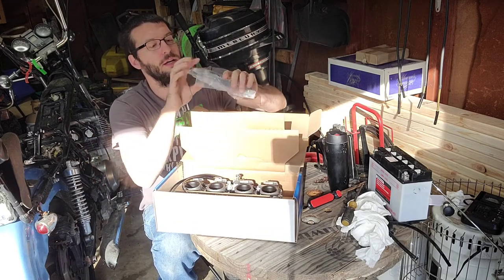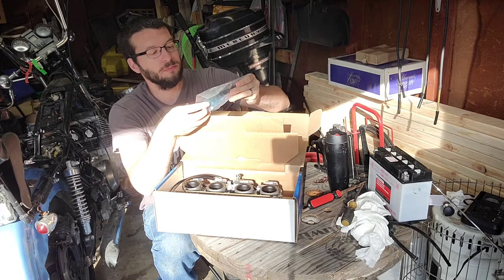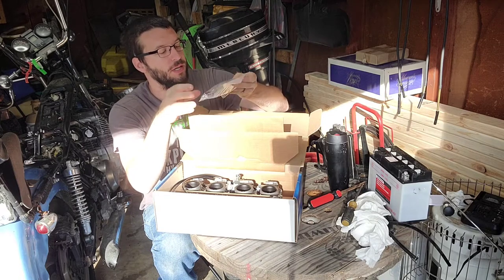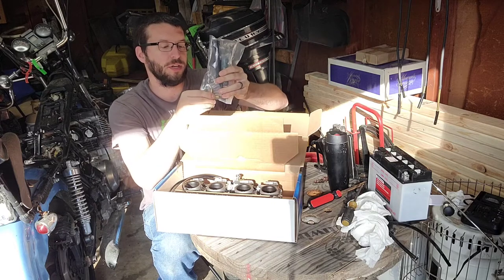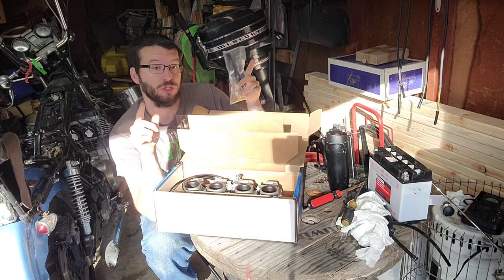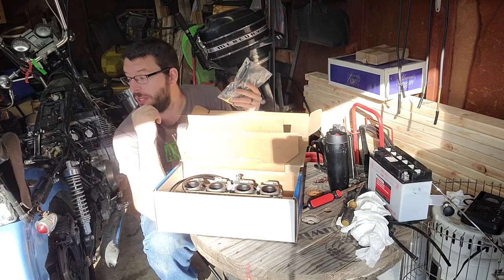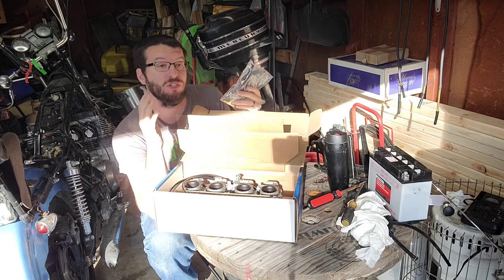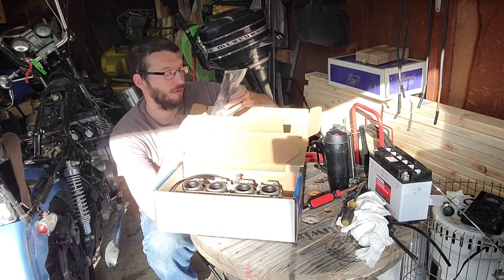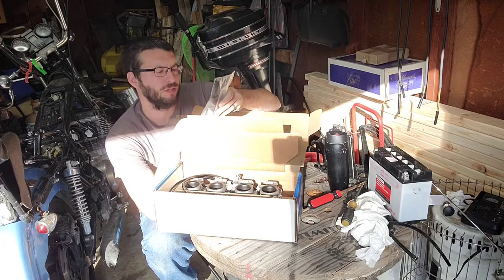We've got jets, zip ties, fuel clamps in here, and other little miscellaneous things. I'll have to go through and look. A barb tee for the fuel, too. I'll probably end up using that to put in an inline filter, going from two into one and back into two. That way I'll have a filter location, unlike the other setup I had, because the air box was so in the way. I'll have to get another tee, but it avoids using two filters.